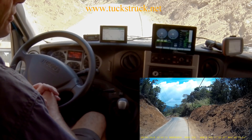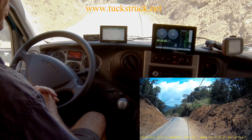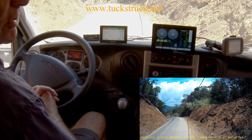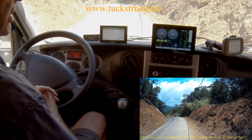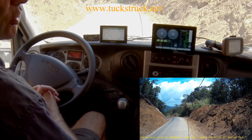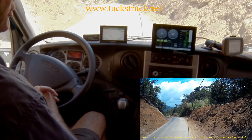We're down at 5,750, so in theory there's quite a bit of spare capacity on the normal brakes. But we have the retarder as well. The Euro 5 engine is incredibly efficient, but the problem is its engine braking is quite restricted, so in high range on a hill like this you would have no chance at all of keeping the vehicle's speed under control.